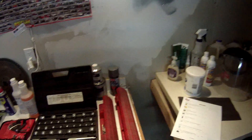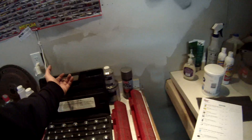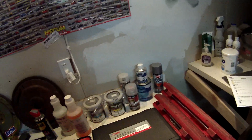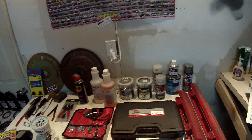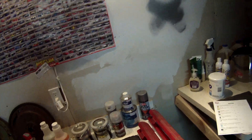A couple other special tools you'll need are the inch and foot pound torque wrenches to make sure you've got proper torque. I'll be painting the case of the transmission black, so I'll be using chassis black, and then the bell housing I'll still keep an aluminum color.